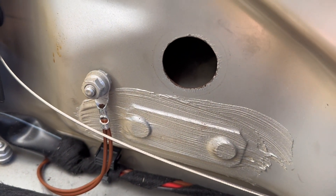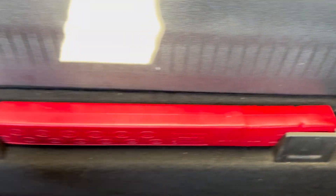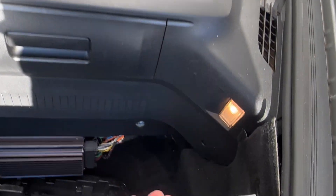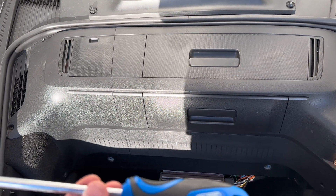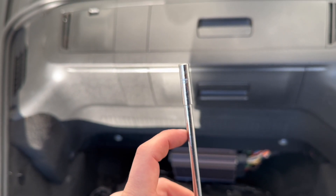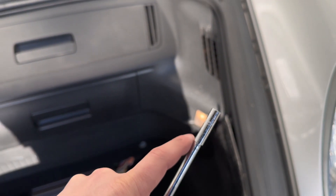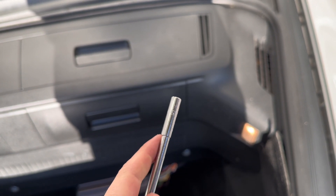Inside is a 5mm which is on a headlight rail. If you remove the two clips at the front, you should have a toolkit inside. Use this tool here to go in through there, twist and pop the headlight out. If you don't have one in your toolkit, you can just buy a 5mm socket end piece. I would recommend a complete piece, not a quarter drive extension and a 5mm socket, as sometimes it is quite tight in there and the socket can pop off. If you are going to do that method, I would highly suggest using a bit of tape round there to seal it to stop it dropping off and not going inside the wing.